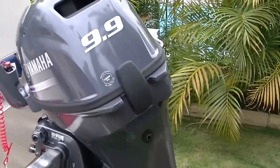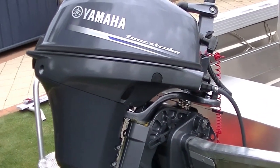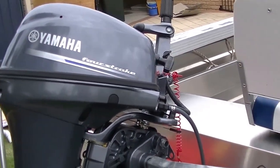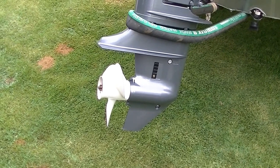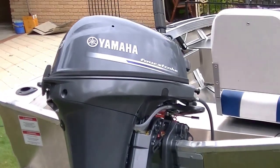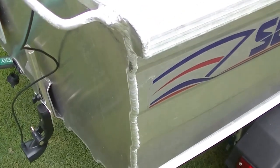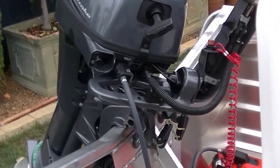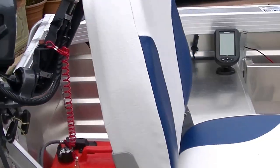I've chosen a 9.9 Yamaha 4-stroke rather than what would have been better as a 15 horsepower 4-stroke. The reason is weight — it's easier for me to lift in and out of the car and load. I do feel the prop is a little bit small, and I'll try the next size up in diameter and pitch. It will get up on the plane but only at half to three-quarters throttle. I also got a bracket made for the transducer so I didn't have to drill into the transom. Otherwise, nice little motor — plenty of power, just the prop slips a bit with this size and weight boat.